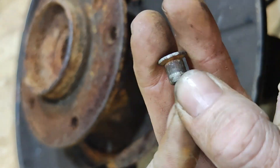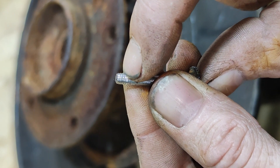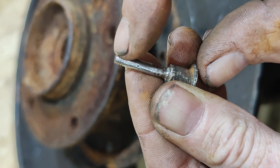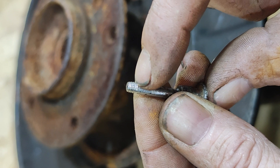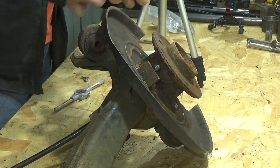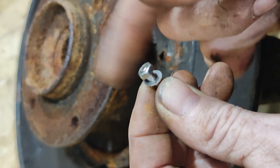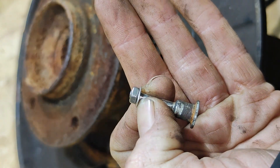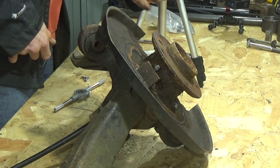It makes no difference to the operation of these. What you want is just the thickness of the nut to be threaded on the end of this. Anything more, you're going to put too much compression on there and you could bind the spring — there should be some free play. Anything less than that, you're not going to get full engagement. So there you go, a little bodge-and-scarper tip for you. If you're in a bind, you need to get things done and these are pulled through on you, that will do the job.